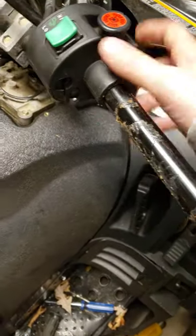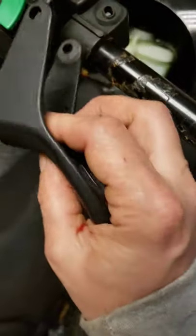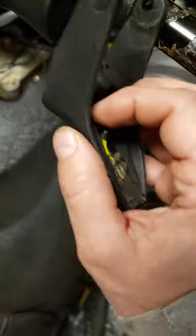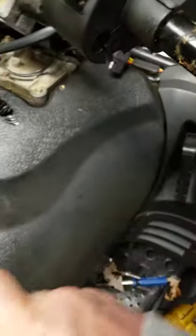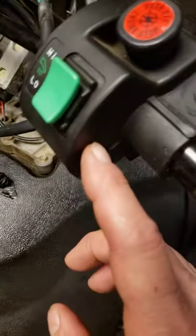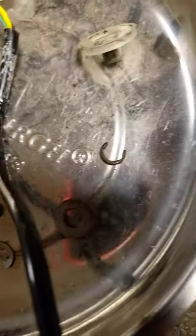I'm going to try to reuse that. There's a screw there you've got to loosen up — that holds it tight on the handlebars — and then the throttle cable. You just kind of pull it away, grab it with the pliers, and then it comes out of this part right there. Then you have to feed the cable down through and there's a small little clip there that you have to remove off the end. Don't lose that — that's kind of tricky. Then you slide it off and put the new one on.